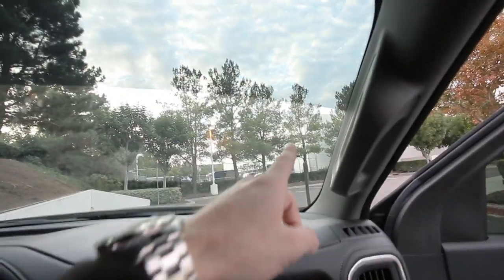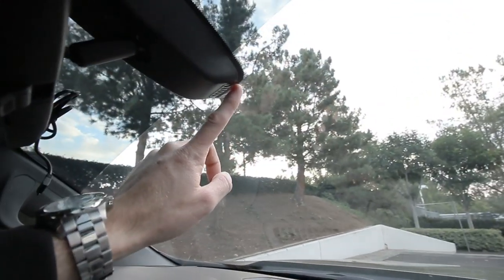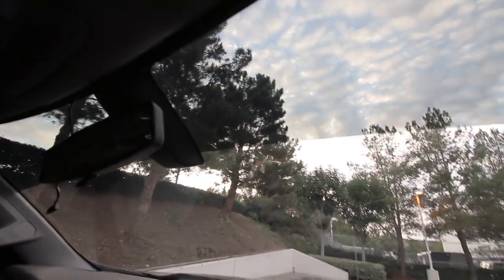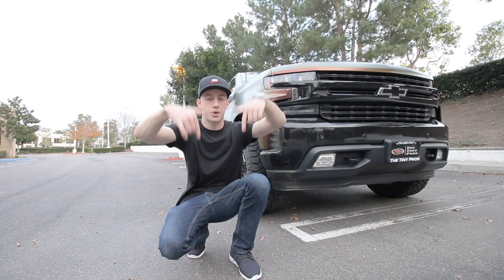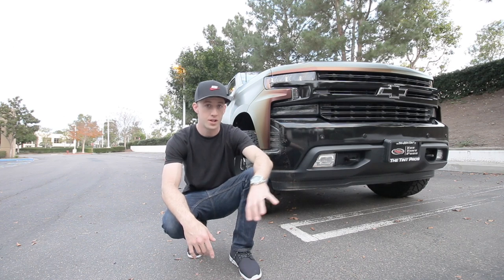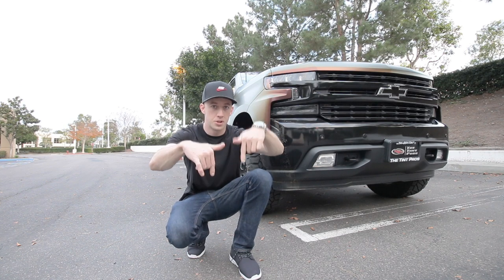This time around, the tint came out absolutely flawless. The mistake we made before was making it nine inches from top to bottom on the right side, the left side, as well as the middle. This dot matrix line right here was right about nine inches, so given the curve of the windshield, you need to make sure the left and right sides are where you want them, and the middle falls wherever it's at — that's how you get a nice, clean, perfect look. Huge shout out to Silverado Ownership 101, link in the description below. Spencer, you have really helped me out, as well as a ton of other Silverado owners who have the 2019s and up. His videos are a lot more dynamic than mine, so check him out.